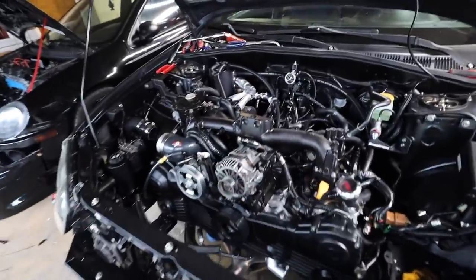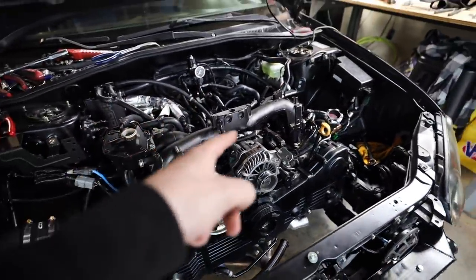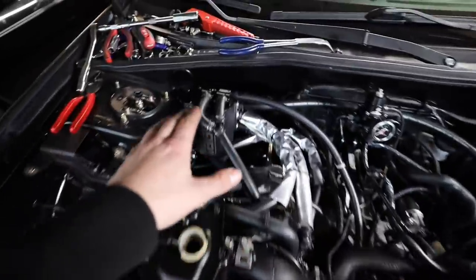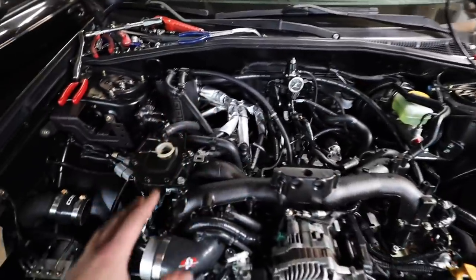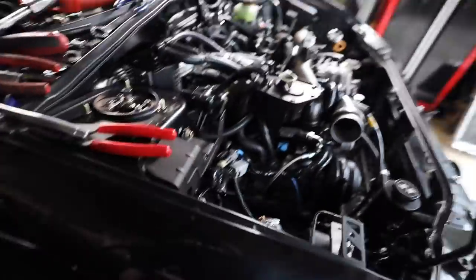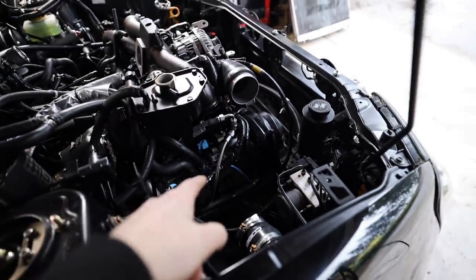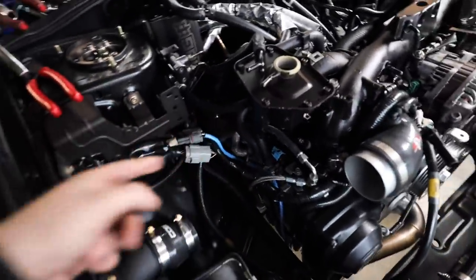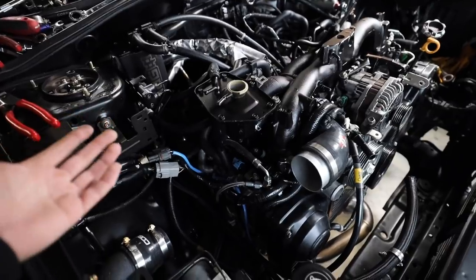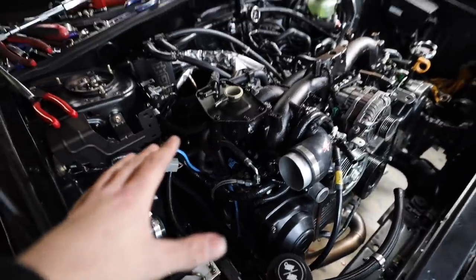It's been a little while since I gave an update. The intake manifold went on no problem — just dropped right in. After that, went ahead and got the AOS put in, ran all the lines, got everything cleaned up. Got the oil feed set up for the turbo — we have a T-fitting coming off of the AVCS. That stainless steel line you can see without the heat sheath is going to the back of the block; the top one feeds the turbo. This is how FP suggests it — it just replaces the stock line.